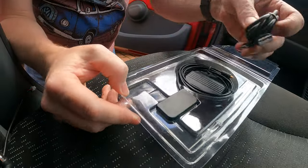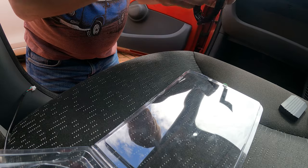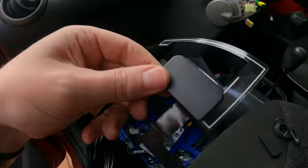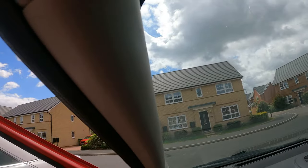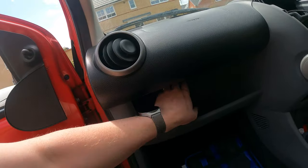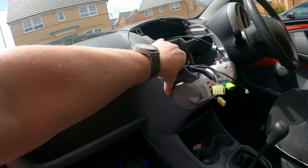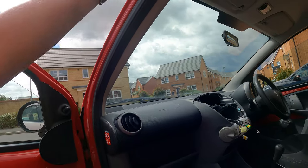So this is our DAB antenna. You've got the USB cable which connects into this tiny little box here — those two bits will sit behind the dash and then this will sit up on the window. This bit will sit on the windscreen and this, if I remember correctly, is an earthing strap. So what we need to do is take this A-pillar trim out, make sure we can get to that glass nice and easily, run this cable down here avoiding anything near the airbag, around the cross and back into here. There's a lot of access behind this centre console and even a little inspection bit where you can pull that down, so that'll make it easier. So get this stripped off, get the A-pillar off, and then go from there.